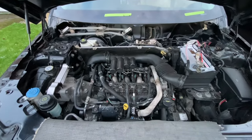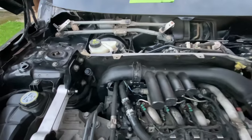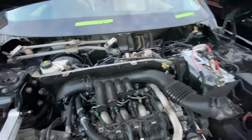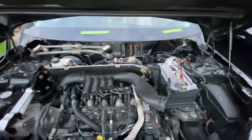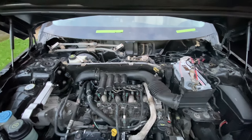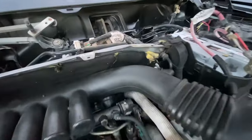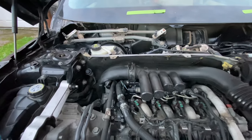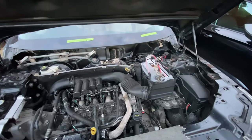So here we have the bulk of the engine back together. The air intake pipe is reattached and the rear bulkhead is fitted. The only particularly difficult part of that was a double grommet down the back just beside the battery - there's a slot in the panel to get it through and making sure it's lipped in correctly is a bit fiddly. I obviously need a new heat mat at the back and as I thought it ended up basically getting destroyed trying to get it back on. Scuttle panel next, and then the air filter box and I think we're getting there.